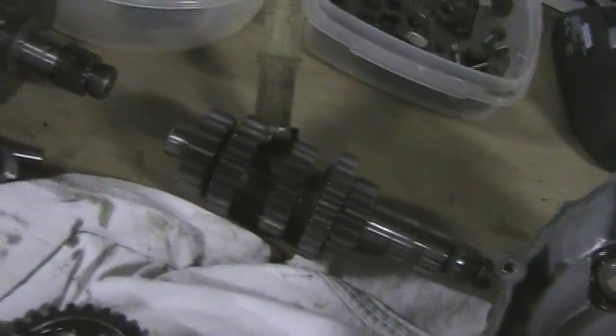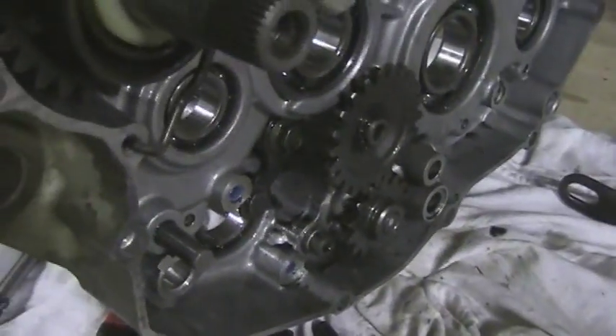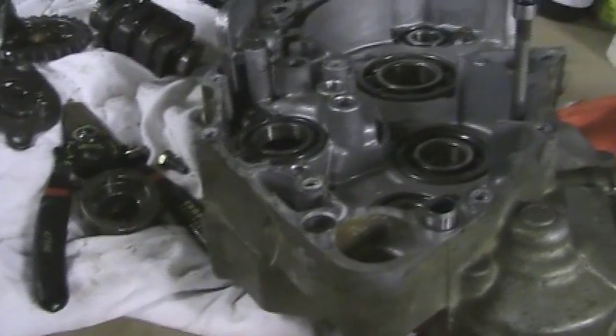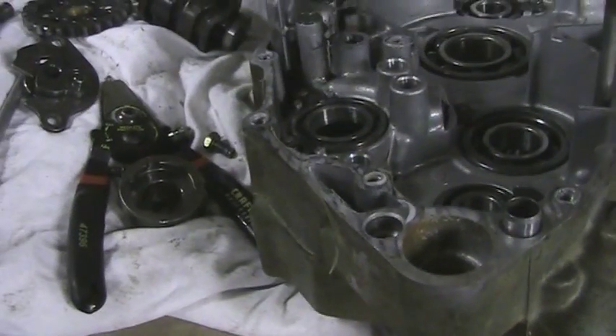You didn't probably learn much on this, but that is taking the complete transmission out. You can see there's nothing left in the case but some bearings and a little pump. The kickstarter is still in there — I'm not going to take that out, it seems fine, no reason to fiddle with that spring. There you have it. Please feel free to rate, comment, ask questions, and obviously subscribe. Thanks again, as always.